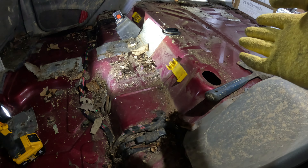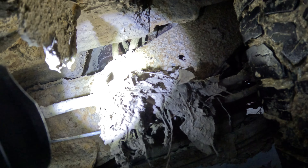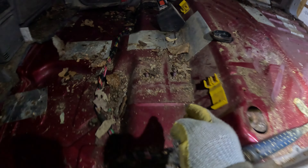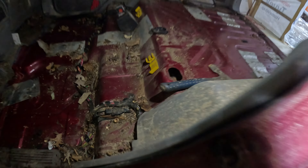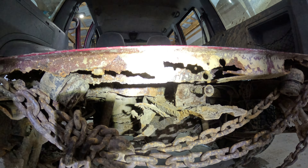Typically whatever vehicle I'm working on is covered in mud, so what I like to do is go up and find those lines where they go into the tank, then come up here and draw on the mud — right about parallel to where it's at. So you can see the marks I made. Open the door, follow that mark right on across — that's how I come up with that measurement. Then the same thing on the back: you can see the fuel tank in the middle, the sending unit's right down the middle, come up here and make a line in the dust.